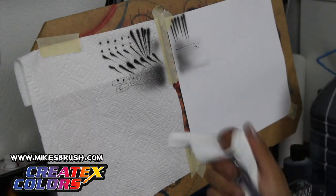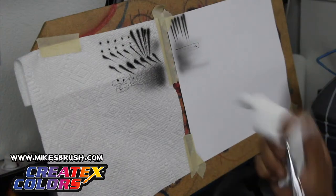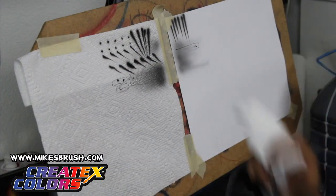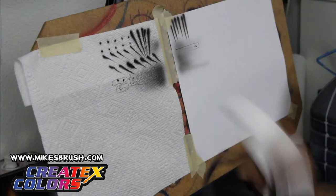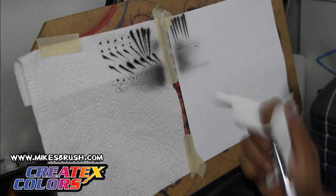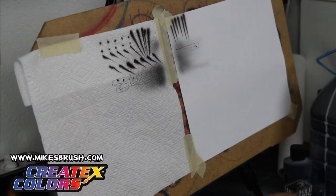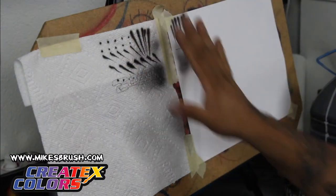Especially when you're painting on something non-porous, it becomes more and more apparent that something needs to dry. When it goes from wet to dry, when you just notice that wetness look go away, that's the flash. So when you work with unreduced paints, they flash over pretty quickly, but as you add more reducer, depending on how much you add, the flash time can be increased quite a bit. There are ways to make sure that your flash time doesn't get ridiculous, and that is by making sure you don't overspray your paint. Even if you have over-reduced paint, you want to avoid caking it on, because it'll just be wet reducer, right?